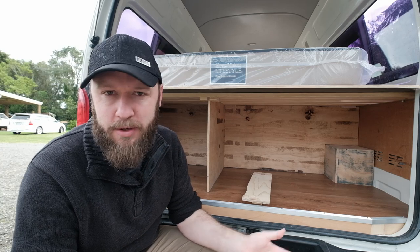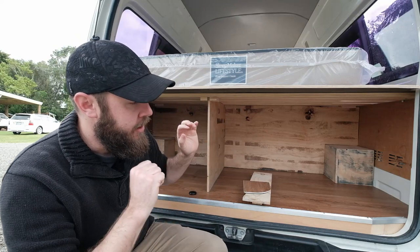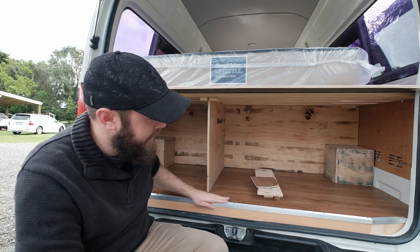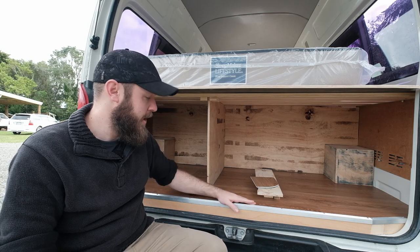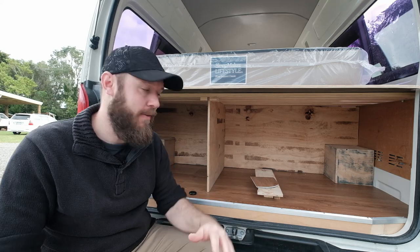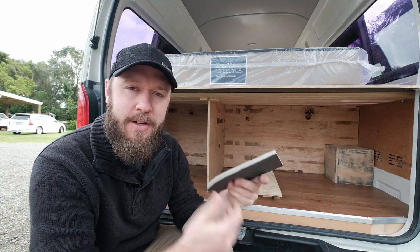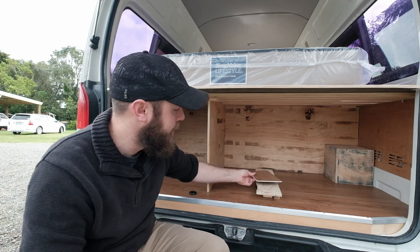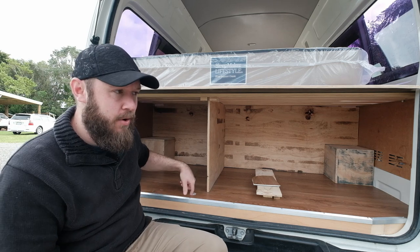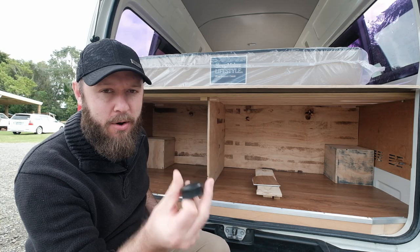Once the plywood was cut and sitting on top, I sealed all around the edges to make the entire floor waterproof, and painted the plywood so if anything spilled, water wouldn't get underneath and rust out the van where I couldn't reach it. Then I put laminate click-together flooring on top — also waterproof — and added aluminium trimming brackets around the edges and high-traffic areas to protect the slightly brittle edging material. I also had to account for access holes for the spare tire and fuel pump.